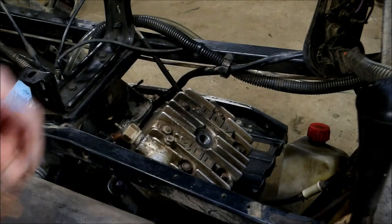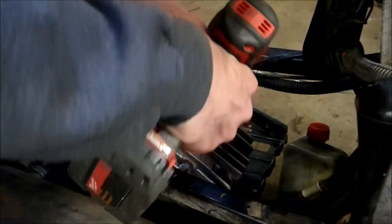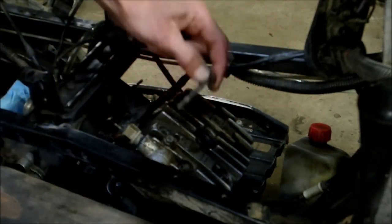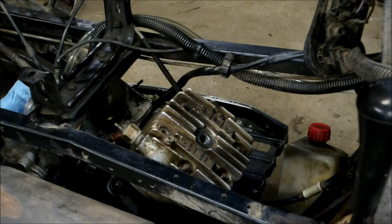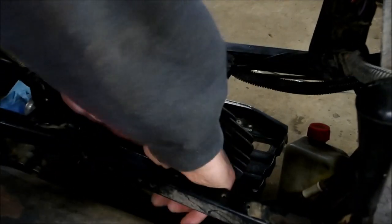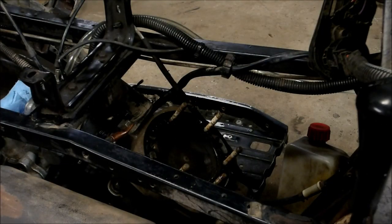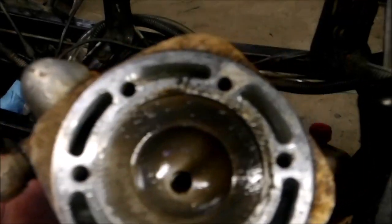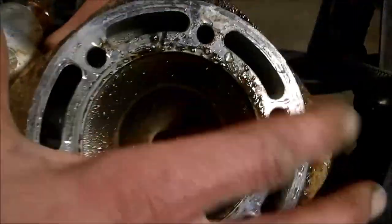So disconnect your hoses, drain your coolant, make sure you disconnect this. There should be about two, four, six — twelve millimeter nuts. Now they come off. See, the stud came out of that one. I've got lots of coolant in there. See it inside, it's all soaked. What happens is sometimes your engine overheats and your head warps, and then once your head warps it doesn't seal correctly.